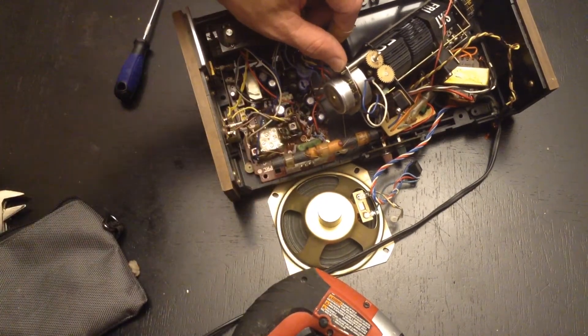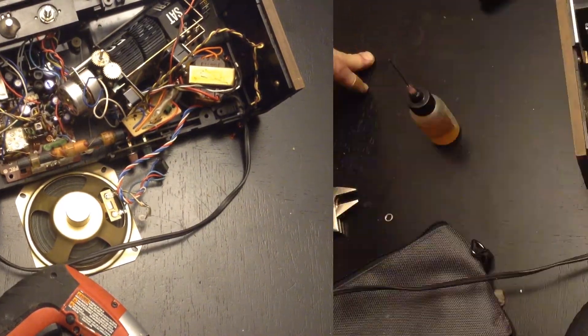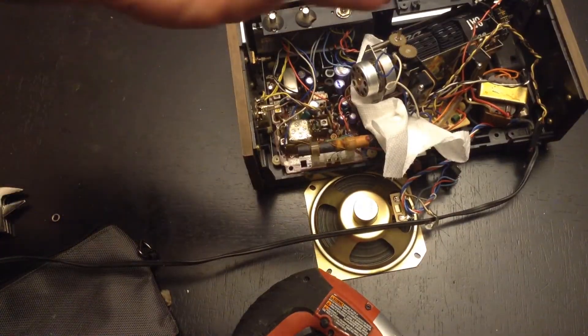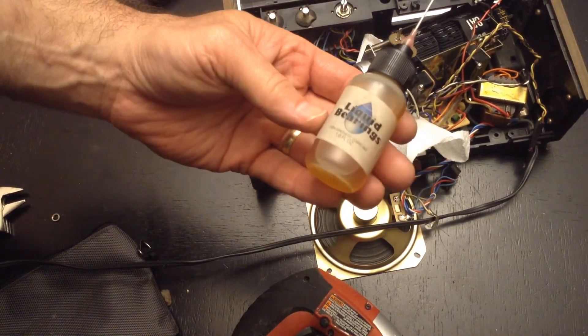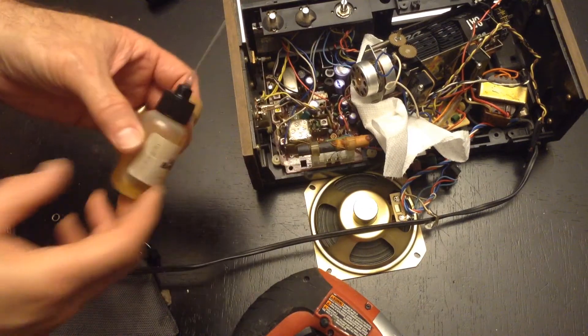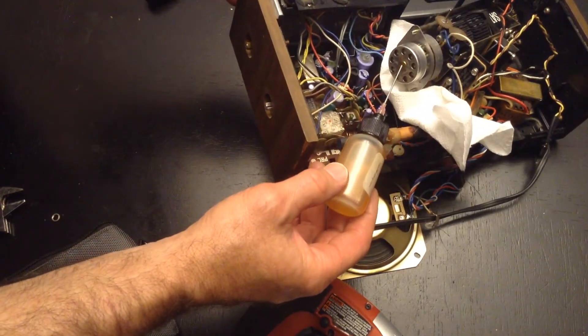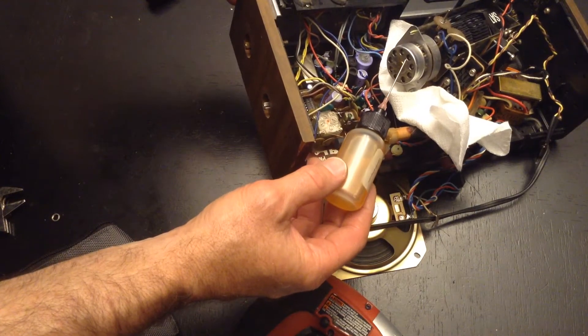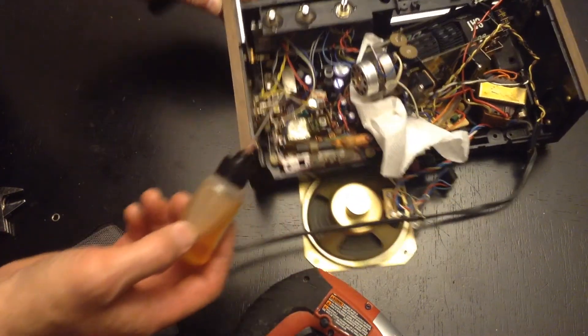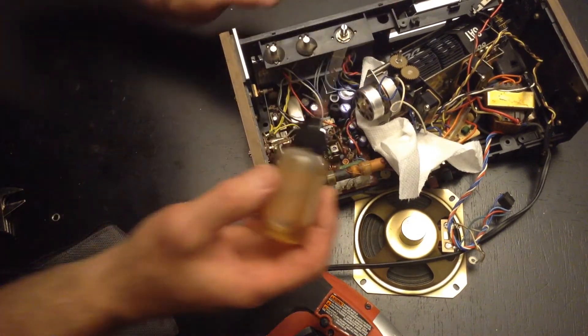What I'm going to do is put some oil on the axle and hopefully that gets inside the axle where the grease is, lubricates it, and gets it going again. You can use any kind of oil really — this is a synthetic clock oil that I'm going to use. You can see the axle pin right there in the center, but you're going to put the oil on the back side of that so it drops down, gets on the axle, and works its way in.